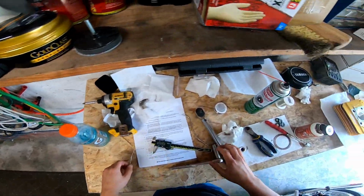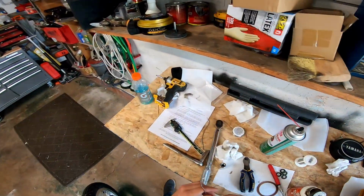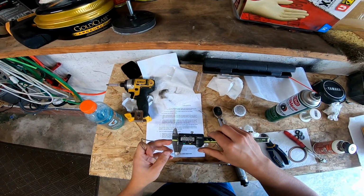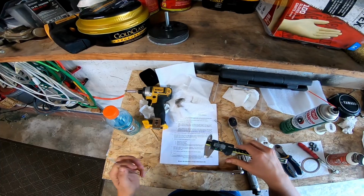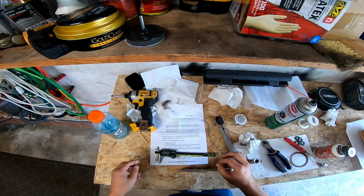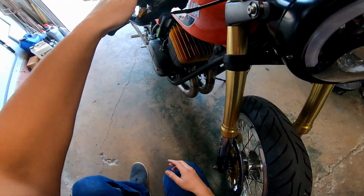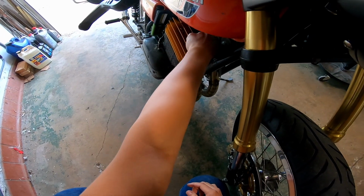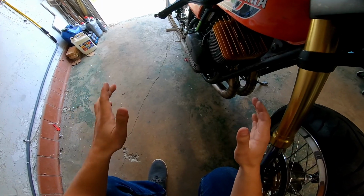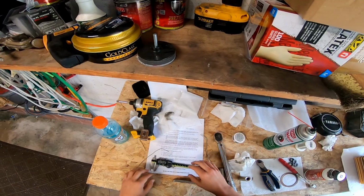All right, so I went ahead and measured the squish a bunch of times with the solder, and I realized I'm an idiot and the caliper was not fully zeroed when I started. It just had a little piece on it, so I had to wipe it clear. So now what I'm getting is 33 to 31 for that solder width. This side's about 33 and the inside's about 31. I did some reading, and about 30/32 is the tightest you want to go. So I think for now I'm comfortable with doing this.